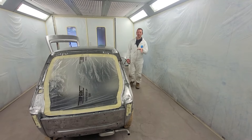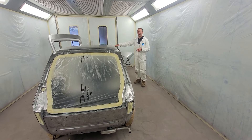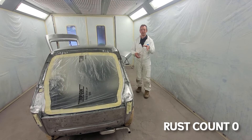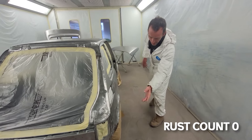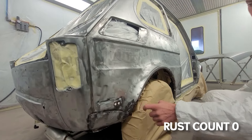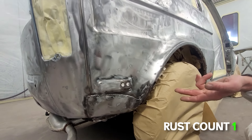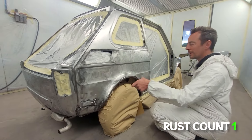That was a lot of dusty work. We've managed to get all the paint off the Fiat — it's now all in bare metal. We knew we were going to find some rust, we always do, but we found more than we wanted. Down on this arch it's just loads of bad patchwork. Some of it's solid but it's next to a load of rust that was absolutely full of filler. A lot of the time it's easier to just get the metalwork right than try to make that shape out of filler.